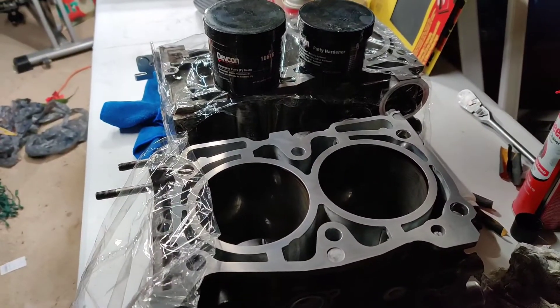I'm basically just gonna send this motor until it blows up. We're just gonna see what the hell happens. I have no idea if this is gonna strengthen anything at all — I just want to try it. I want to see if we can get this thing making 700 horsepower somewhat reliably and not blowing up. The internals going in are CP pistons that were originally in this motor, Manley I-beam rods, all with upgraded hardware. The pistons have upgraded wrist pins, and we're doing new bearings obviously — so it's gonna have the recipe to hold the power, if this was a closed deck block.